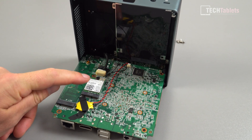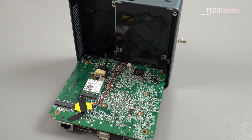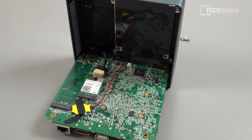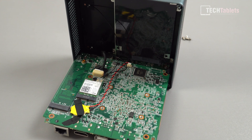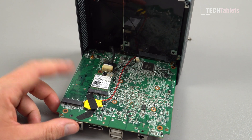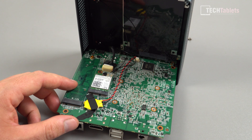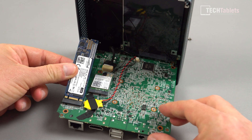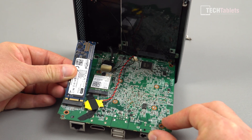The lid is made out of plastic so that's going to aid wireless range and reception. The good news is we can upgrade the wireless card, which is great. We can install Intel's wireless AC9260, which is a gigabit wireless card with Bluetooth 5. The one they include is the common wireless AC3165 with maximum speeds of about 400 megabits per second. I'm going to install a SATA 3 M.2 SSD, since that's what I have spare — you just slot it in like so.